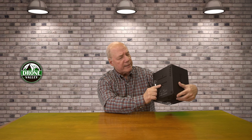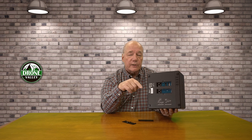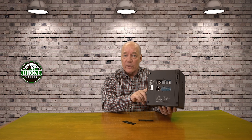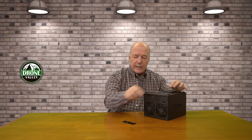On the bottom, there are two slots for NVMe SSD drives — flash drives for cache acceleration. If you pop those in, one acts as a write accelerator: data firing from a computer ends up in the flash drive until it can de-stage to the disks, giving you extremely fast write performance. The other is a read cache, which means if you're doing video editing and pulling a lot of files off the unit, it'll stage them in cache to get data to your computer even quicker. It's a really intelligent box that does everything it can to deliver and store data fast.